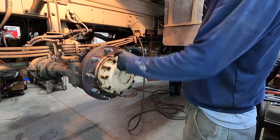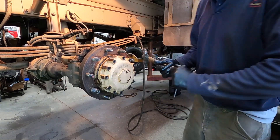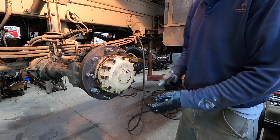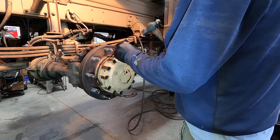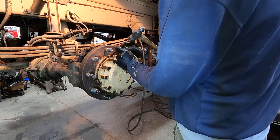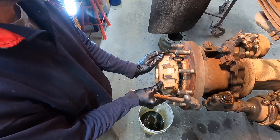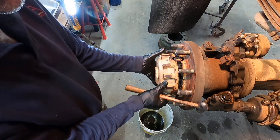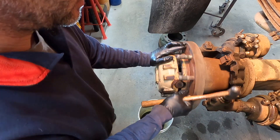The cross that the spider gears are on is stuck in the cap. The last one I did, I pulled the whole thing out together, but it was a little awkward. I want to see if I can just get these to come out of the cap by hitting them — yeah, there we go. Turn it and get the other side.